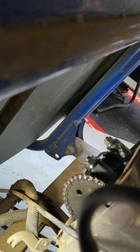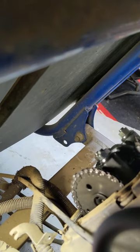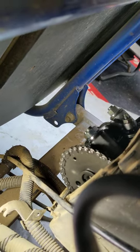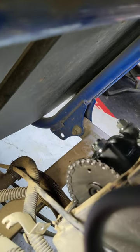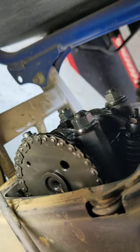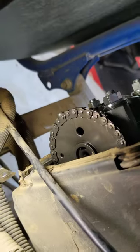Easy way to do that — come around the other side of the engine and turn it with the flywheel. Always go clockwise; there is an arrow on your flywheel. This is top dead center right now. You can see your cam gear as you turn it — see that line? Keep turning it until it is parallel and in line with the top of the head.